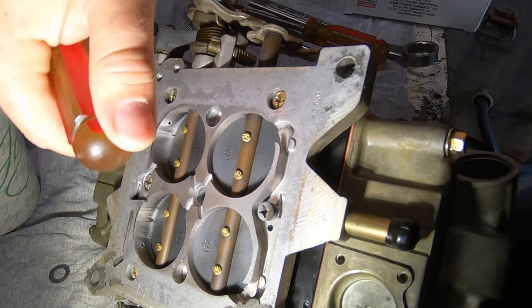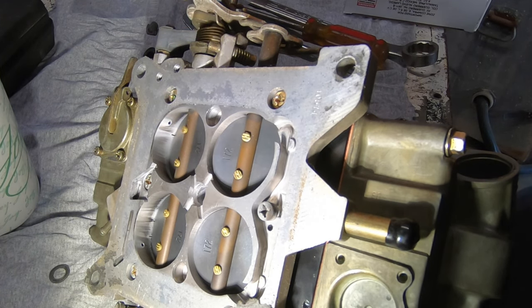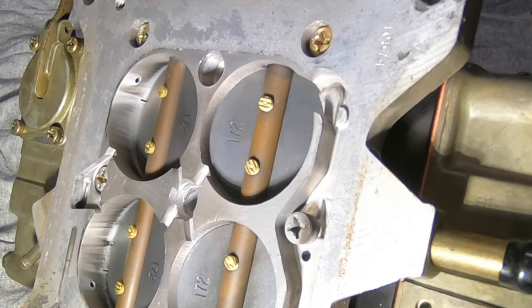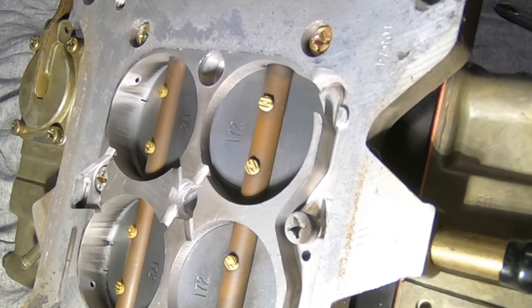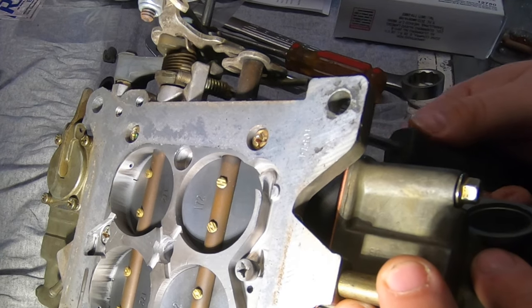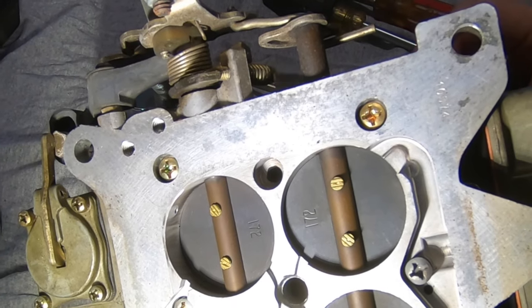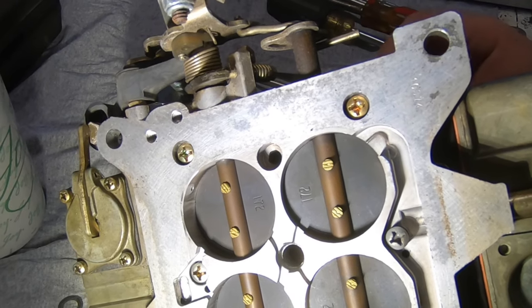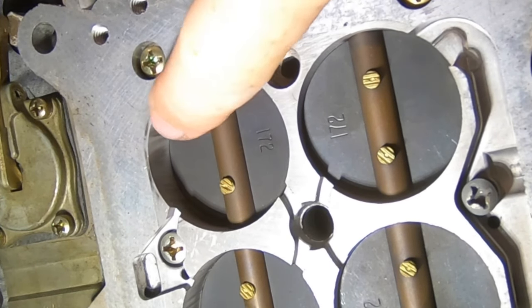In order to get the AC to work properly on the car I idled it up by adjusting the idle screw, and the problem with that is these transfer slots are only supposed to be showing 32 thousandths of an inch — basically down to where they're square. If you don't have it set up like that, you're no longer using just the idle circuit; you're actually on your primary circuit whenever you're idling. I really need to idle this guy down. The choke is now open and these guys are now set to where they're square — that's what you want so that the idle circuit is square.